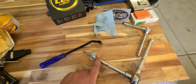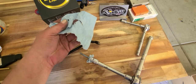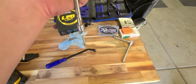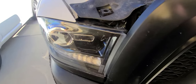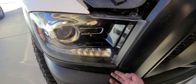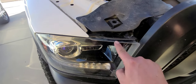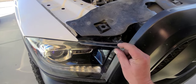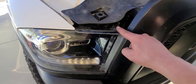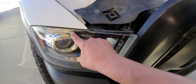Quick tip when you're putting the long bolt in that goes straight down: just take a shop rag, put it over that flat end, shove it in there, and rip off the excess around it so you can see the bolt — and now when you put it in there it's not going to fall out. One other tip when reinstalling: take a pry bar or panel tool, put it right under here, and pick it up so you can make sure the line is good right here. That will make sure when you shut the hood that the line is good. There is some movement up and down on this bolt, so I suggest putting this one in first and then the bottom one, so you can get that line straight.